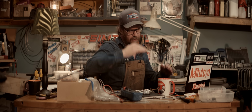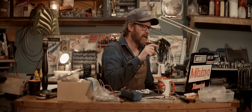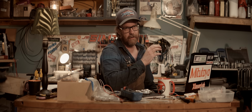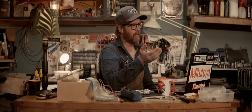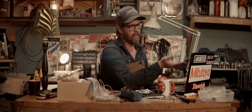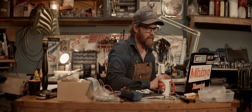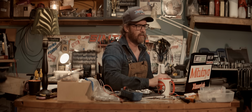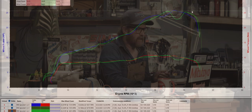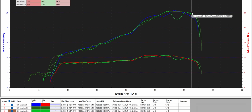It's a little bit shifty between 10 and 9.5, but it seemed like most of the numbers gave like 9.6. So I locked the gear ratio at 9.6, and then I reran the runs. That's the beauty with your dyno software, it's logging raw data, so you can change the run conditions and redo the runs. It is actually revving higher, and it's actually making power for longer.